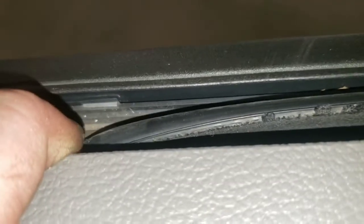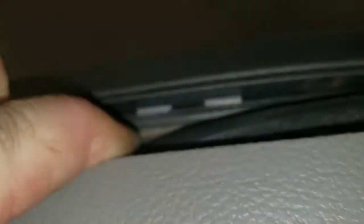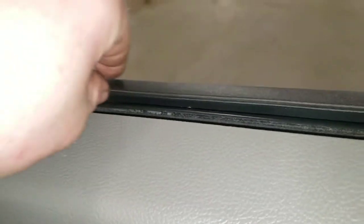Back here behind this window channel — I'll go to the other side so I can show you because this side's already done — there are these little metal clips. They say water can get around them. You clean all this out, and you take some TA-30 sealant and seal from here all the way down. Then you take a foam strip and re-foam that whole entire piece to basically seal up that door.